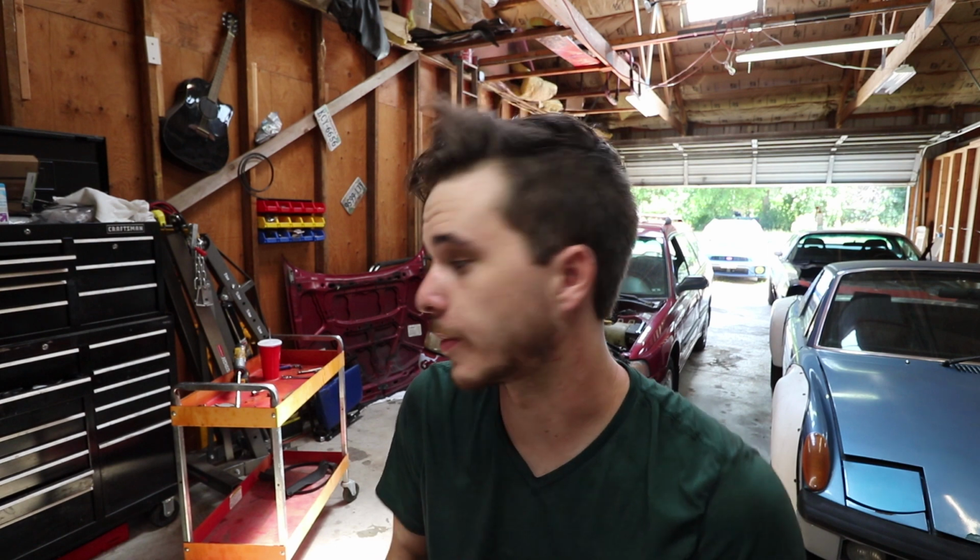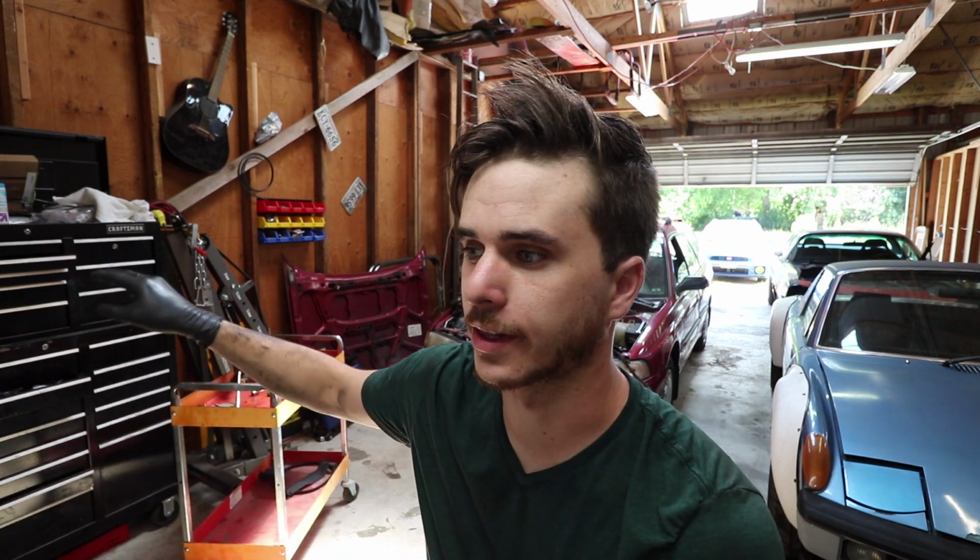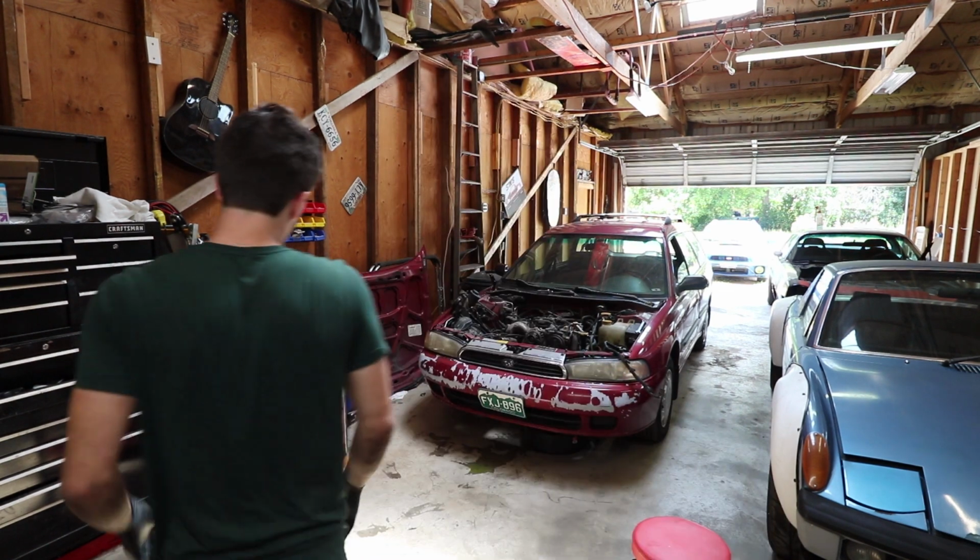So when you're working on a car that you've never worked on before, when you pull a tool that you think is going to be continually used, leave it on your bench or on your cart or whatever you're using, and then you'll have it there with you. Now if you don't know what size a bolt is and you grab say a 13, 14, 15 because you know it's somewhere in that range, and you figure out it's a 14mm, take the 13 and the 15 and put them back right away, then you won't lose tools and you won't be reaching for those later.